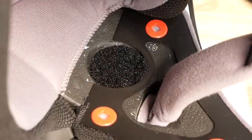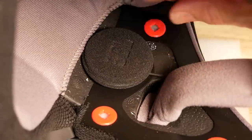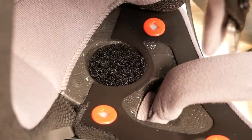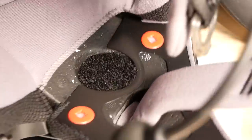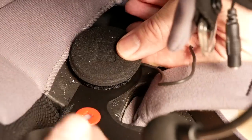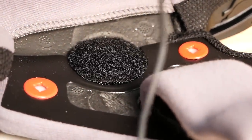With the speakers removed, you can see the little carved-out space that HJC has provided for helmet speakers. It's not quite large enough for these 45-millimeter JBLs, and my original concern was that these are going to stick out and hit my ears when I put my helmet on. They do give you a Velcro pad that kind of raises the speaker up a bit to clear that carved-out foam, so I tried that first. I decided to install this little pad so that the speakers would at least sit properly inside the helmet, though I ended up going back and reworking this, which I'll talk about later.